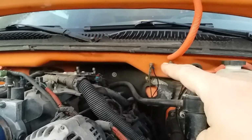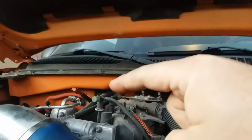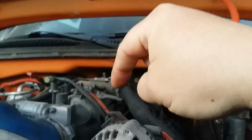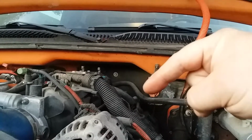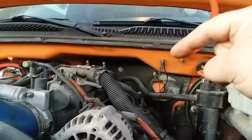And then pop the hood. There is, let's see here, on the firewall, the wire to the right was the one that comes off of the main harness over here and did go down back behind the engine. It felt tight, but it's really hard to get to. So just to be on the safe side, I clipped it and I attached it to the firewall because I could feel the bolt back there, but I could not get it loose. I don't know how in the world they put that on. It must have been before the cab's on. So that ground is there.